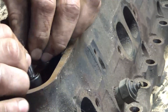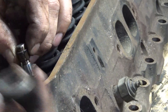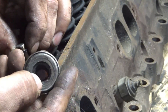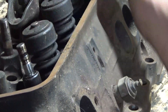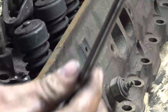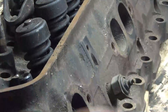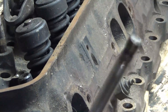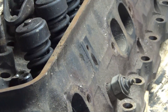They have these two little keepers that stick in the top groove, and they're little wedges. Whenever you push their little wedges that go up in there and whenever you push this down, these could come off and then the valve could come out. This valve is supposed to have an o-ring right here, and it has this type of seal — I think that might just be called an umbrella. I think the other ones have little springs on them. It's machined for the good seals anyway, and it's supposed to have a little o-ring right here that just flaked off.